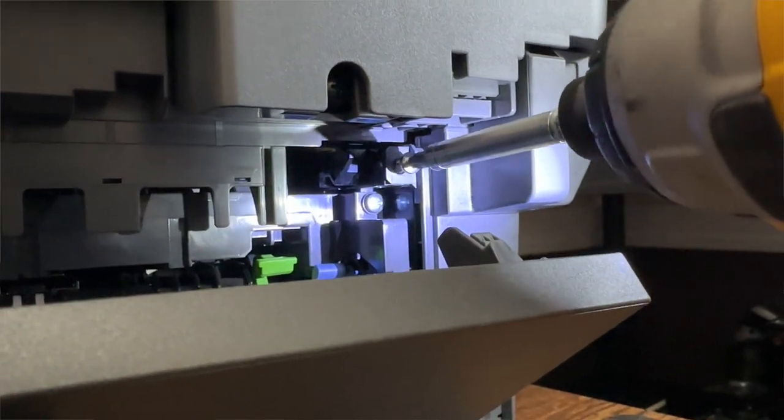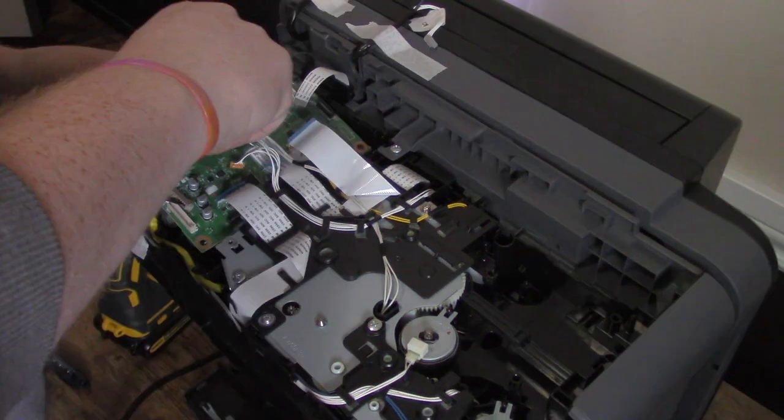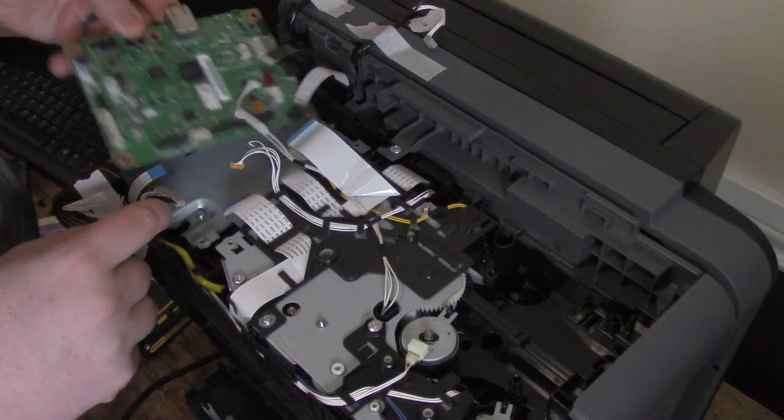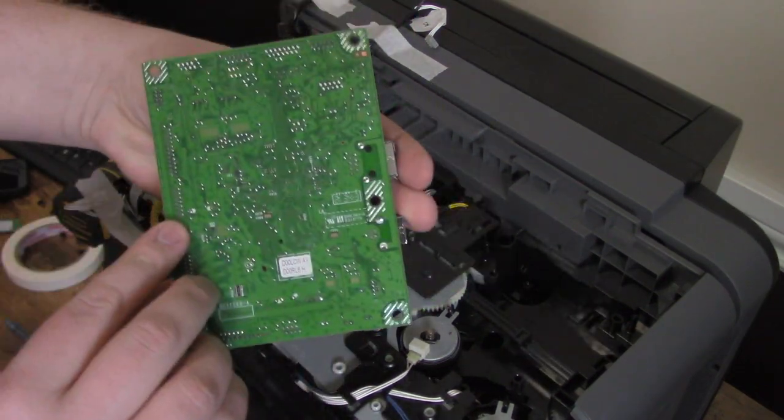The first thing I needed to do was make sure I could reach the port. So I took off the side panel, which is held in place just by one screw and two clasps, and had a look. The main board is super accessible, so I started labeling the cables and removing them. After that, I removed the main board itself — this just took a few screws and the removal of a secondary chip. Nothing was abnormal about the port or the motherboard, so I knew that I could do the replacement.